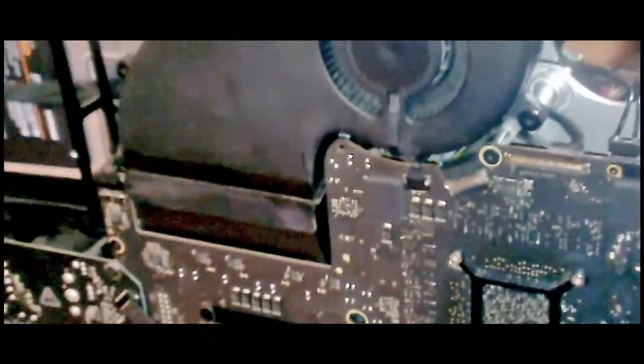Then it's simply a matter of routing the power cable underneath. If you remove the fan — that's not such a hard job, only three screws and one little plug — you can route the cable underneath. I don't think the routing of the SATA cable is that critical, but ideally it shouldn't go right near the processor. It would really be better to route it down here and go that way, because it's not as hot near the processor.